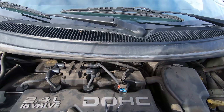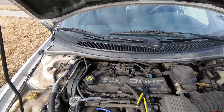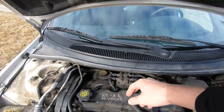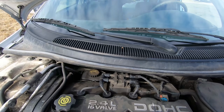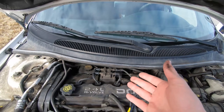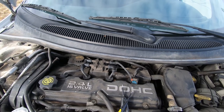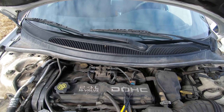All right, so here we are — just tested the connector going to the coil pack. What you can do on individual coil packs: a lot of engines have separate coil packs for each cylinder. This one is one unit, so the fact that the other three are working and one isn't already tells you this coil pack's bad. Just to be sure I tested the wiring — it's good. So we've got a bad coil pack here.